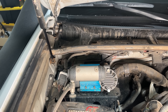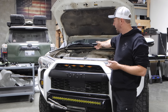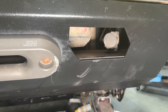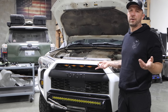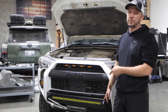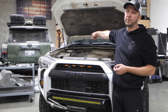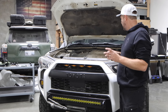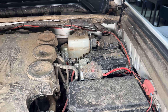I have an ARB single compressor here, and I actually routed it all the way to the side — here's my input — so I don't have to open my hood when I want to fill up my tires on the trail. I have a four-way tire system from Traction Off Road. This was a mistake in one way: in summer it works great with no problems, but in winter that thing keeps freezing and it's a pain to deal with. I might put a secondary one under the hood for winter eventually.